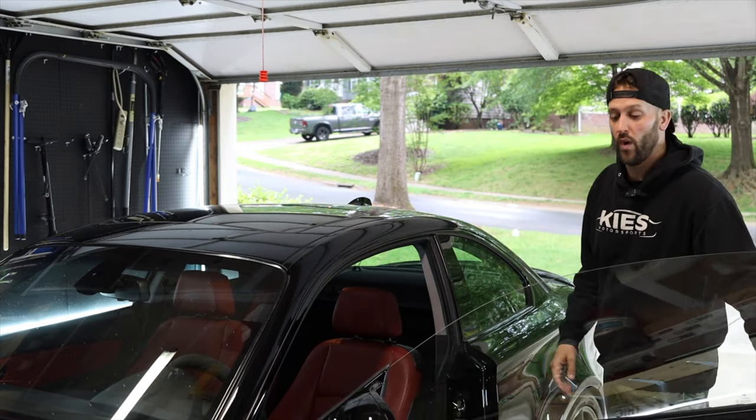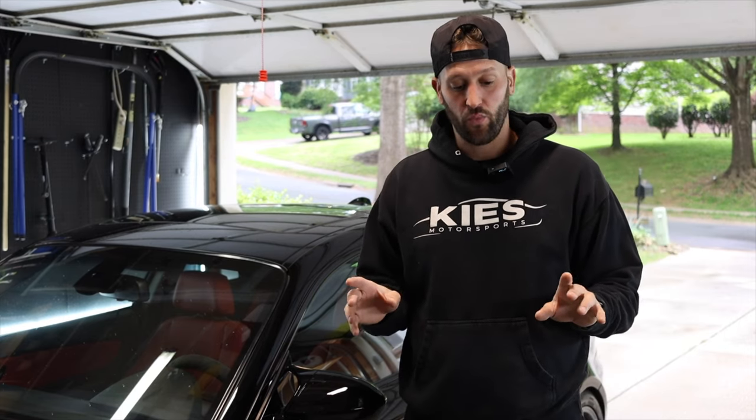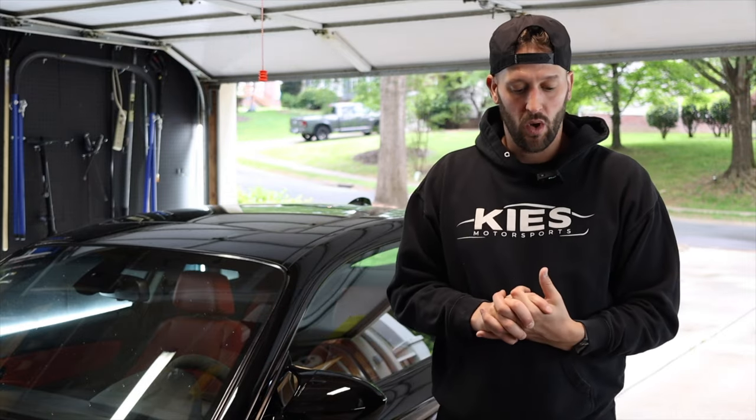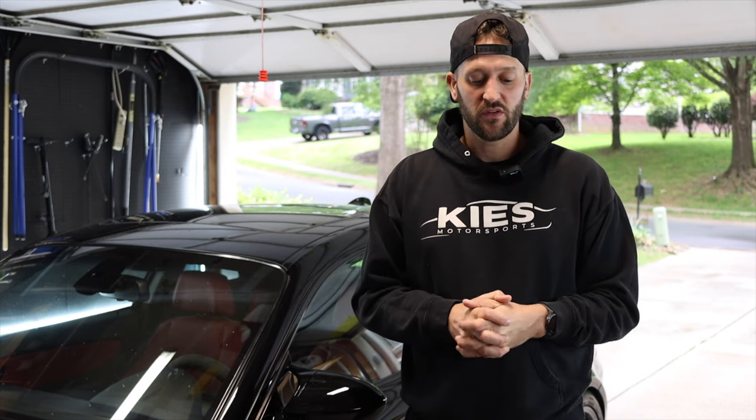We're also gonna go ahead and weigh them. I don't know if there's a huge weight difference, maybe there might be. One thing I will note is that we will be getting an airbag light. Seeing that these no longer have heat, I went with the heatless option. We're in North Carolina, you don't really need it here. And these don't have airbags, so you're pretty much losing all of that, but that's where the majority of the weight is. So we will first get an airbag light because we are unplugging the factory airbag connections. However, I will have that coded out down the road.